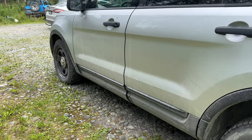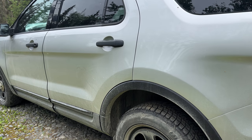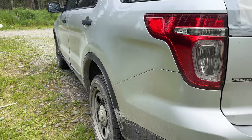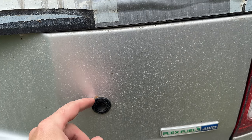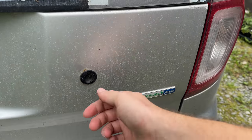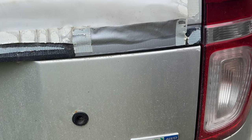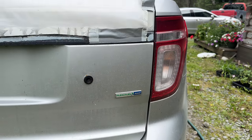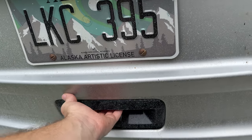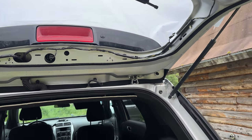Sometimes they do get really gouged up. So when you're buying one of these, if you're looking on public surplus or government auction, take into consideration that the paint may need to be repainted. Also, these really like to rust. I've got an idea for fixing up this area — this is where you'd put the key in to pop the trunk or lift gate. The police department, I think, used universal keys and drilled out all the lock cylinders. I'm actually just going to delete this completely since it's drilled out and a pain to find replacements. With ForScan, I was able to turn the trunk function back on.